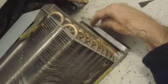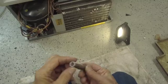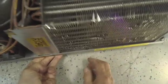you have to push it back and make sure that this part of this chassis here is on top on both sides, because it slides on there. Okay, in the back you see you have to get that lip up, so you kind of finesse it. Okay, so sometimes I'll use a 3/4 inch pipe or something that I can stick underneath here. That allows me to get the back up. By the way, be careful, these condenser fins are very, very sharp.